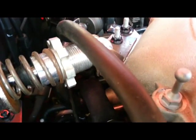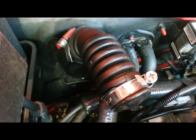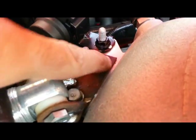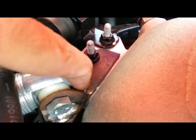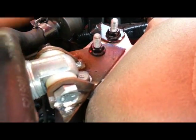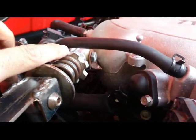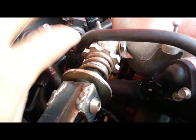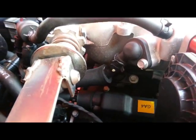I fabricated this bracket here. What I did was remove the sound resonator pipe, capped it off back here, removed the housing, then relocated this piece from over here to here. I fabricated this bracket and bolted it here and here — I had already welded the tabs in at that point. Then it was just redoing the hosing. I still used the bottom hose but swapped this hose in and angled it differently. It was already pre-bent, so it was pretty simple and straightforward.